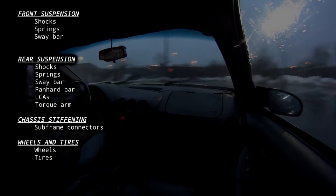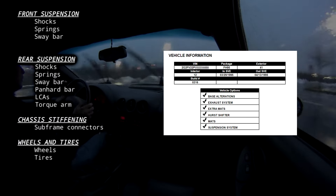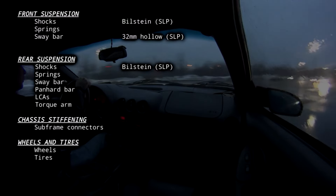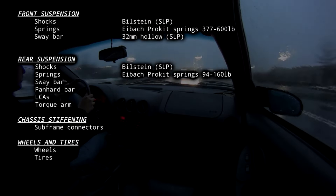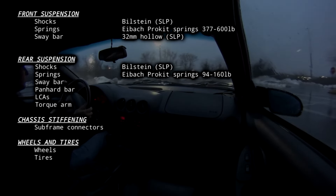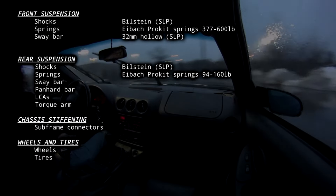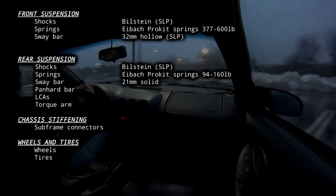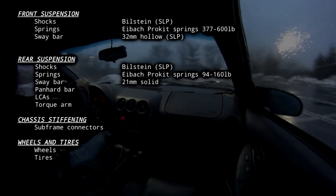Quick overview of the car's baseline setup when I got it in January of 2020. This car is a Firehawk that was shipped with level 2 suspension, but a lot of the original parts had been swapped out by previous owners. The factory SLP Bilstein shocks and 32 millimeter front sway bar are still in place. Somebody swapped out the factory SLP Eibach springs for the Eibach Pro Kit, which is known for being too soft and saggy. Even if you had a Firehawk, it probably should have come with a 19 millimeter rear sway bar, no different from a Z28 or a regular Trans Am.